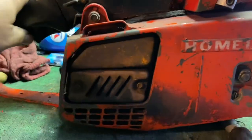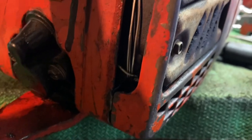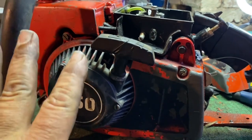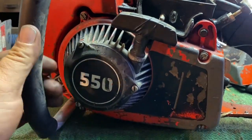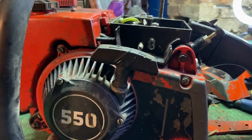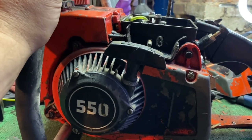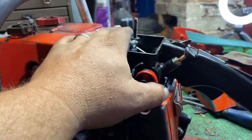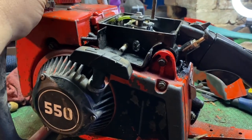The muffler is held together with wire, so I want to see what's going on there and fix that. She has the worst air leak I've ever seen in a saw. You can't even touch it without it shutting off on you. You can get it to run at idle, but as soon as you touch it, she just wants to shut off. She is just barely running because of how much of an air leak it has. It's not at the intake boot — I did confirm that. The intake boot looks like it was actually replaced at one time. I'm thinking somebody may have assumed that was the issue, but it was not.